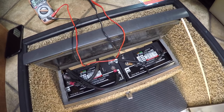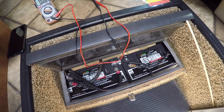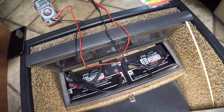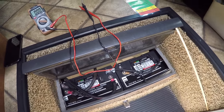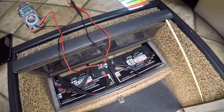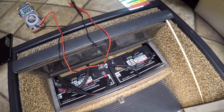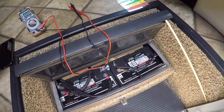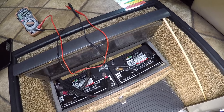And for the first 6 months or so, it worked fine. We could run both Fantastic Fans at night and a little TV watching and some LED light usage and still be well above 50% in the morning, that we could just cut on the generator and charge them up. But this last camping trip, dry camping, we weren't able to do that. Kind of afraid to run the fans all night long, especially both of them. And so it was definitely time to fix my mistake and to get a pair of batteries